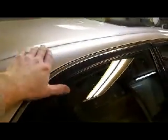But I did this whole quarter, or cleared this whole quarter, last year about this time. And we blended. I did a solvent melt up here, which is still nearly invisible. I'm pretty happy with that. I think this time though, I'm gonna run it right down, all the way down. I don't want to blend it again. And I guess I can. Maybe I'll go a little farther up this time. But I'd hate... I mean, there you can see a little strange reflection, and that is where the blend is, somewhere in that area.